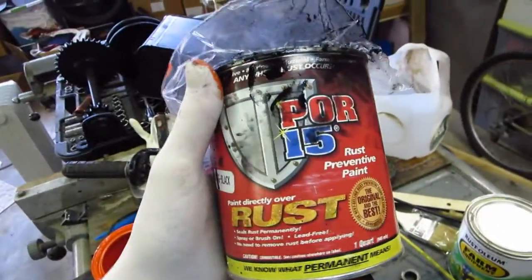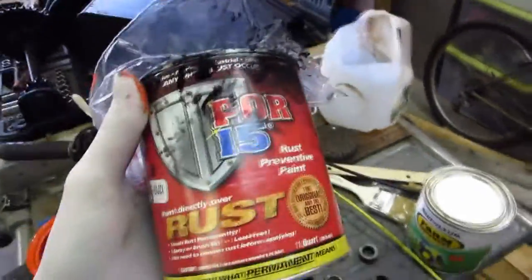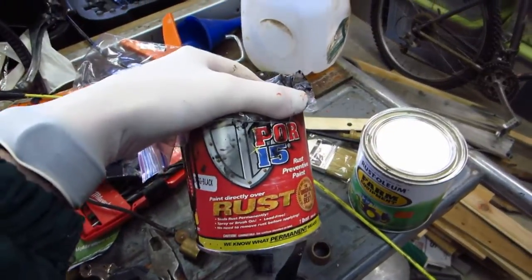I pulled out this really cool paint I have that I got for a project several years ago - POR-15. It goes directly over rust, so whereas I took the time to really clean the body, I didn't really want to take the time to clean the gears and the wheels as much. I did take the time to degrease them. POR-15 is really good, but it's not UV resistant, so I got normal black Rust-Oleum to paint on top of that, which I still have to do.